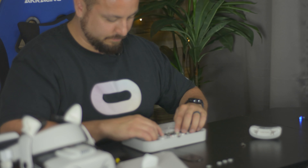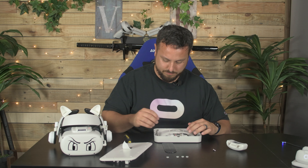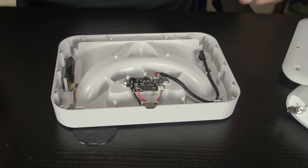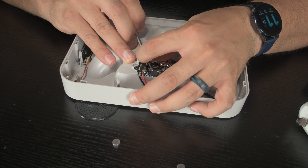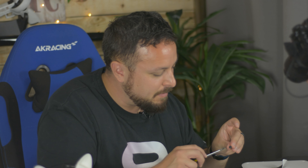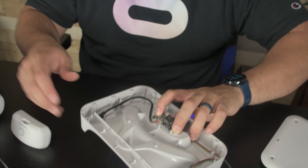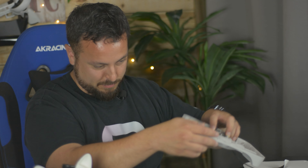With all the screws out and all of our parts safely stored — rubber pads, everything magnetic — we've got a couple little circuit boards here, nothing too intense. I'm going to look for where the sound is coming from. If you take the magnets out, make sure you put those back because those are what's hooking to your battery. There we go — a little piece that has a sniper reticle, like a circle with a plus in the middle and an arrow. That's the little piece we want to take off. I'm going to take this disc out right here. Battery is charging, magnets are right. Remember, if those magnets fell out or switched, you need to check them to make sure they still have the correct polarity — otherwise they're going to be pushing your battery back off. Let's put this thing back together and then we'll do some final testing to make sure we've finally disabled this sound.